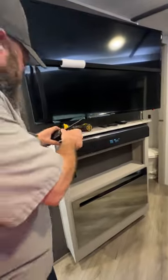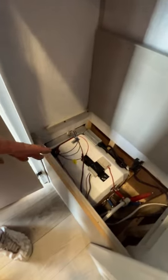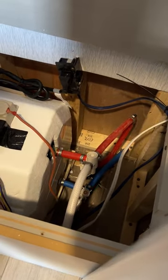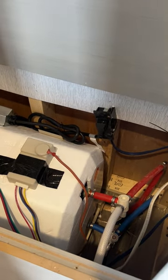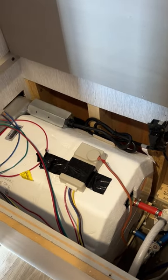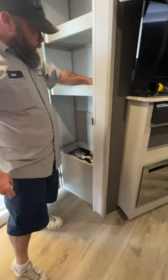Inside here is going to be where you would bypass and un-bypass the water heater. So there's going to be two knobs on there — one on the hot side, one on the cold side. Basically, you're going to deal with these when you go to winterize your coach. Right now they're in line with the water heater. When you go to winterize, you're going to turn those knobs. The best philosophy is if you're turning one, you're turning them all. I will show you where that other knob is — it's going to be located in the bathroom near the water pump.